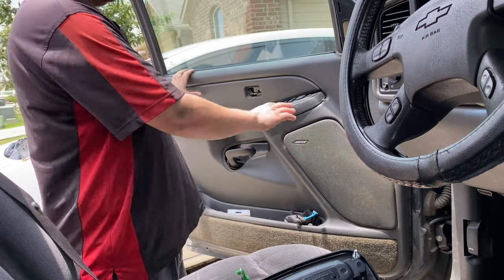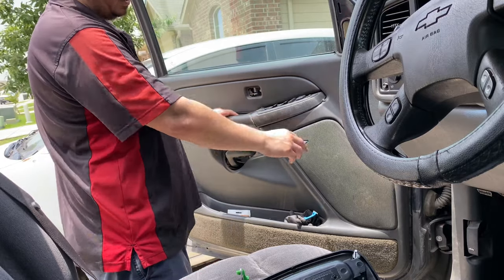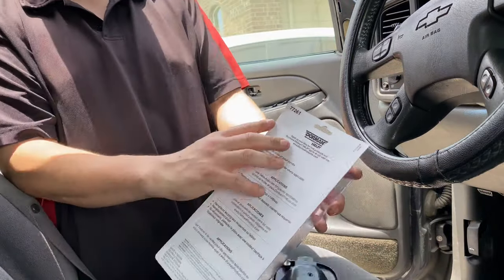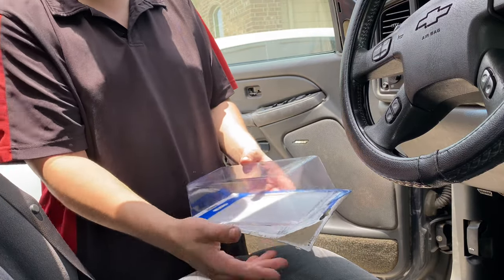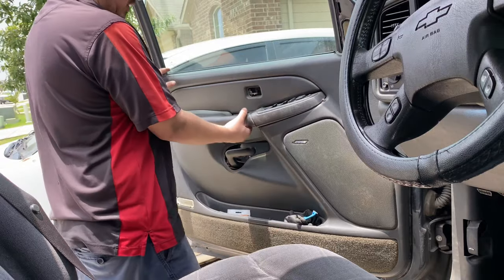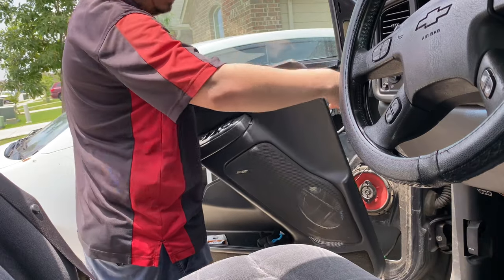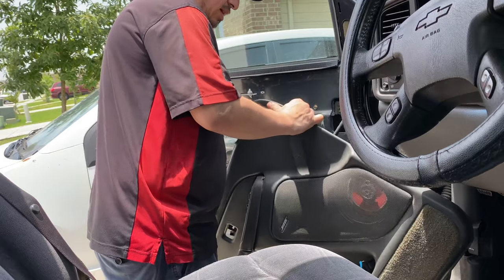As far as the panel itself, since we already took off those two bolts, the clips that go around are just like little hooks — so all we're gonna do is pull it straight up and we should be able to take it off. This is the part number for the Dorman — this one was $35, but I'm gonna try to find a cheaper one on Amazon and I'll put the link in the description. On this one we just pull it straight up and then go around the handle. We do have wires for the speaker but I'm just gonna leave this hanging here.